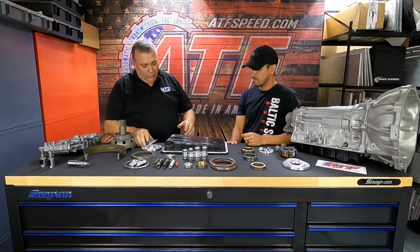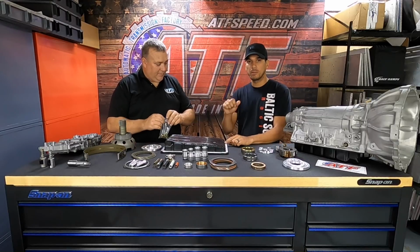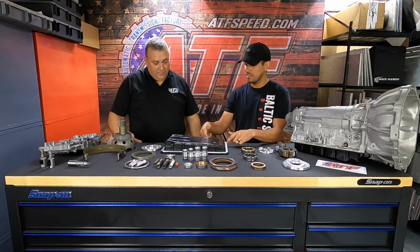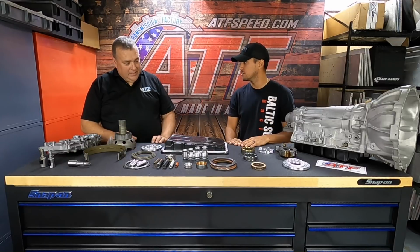No more leaks. I've experienced leaks myself in my Supra, and you always want to be so fragile with these small 10mm bolts, so you kind of just slightly go around and get them all a little snug. But the second I got the pan stiffener, you definitely get a lot more confidence, and you don't even have to tighten them that hard, as them all combined can really get that pan snug to the transmission. So that's a must, and you sell that as just an individual product as well. Yeah.